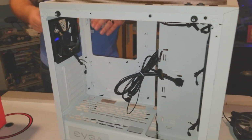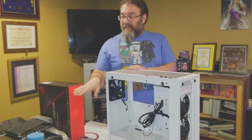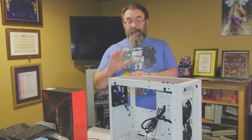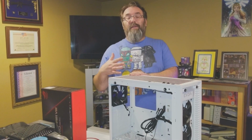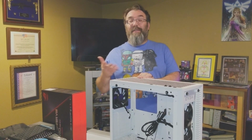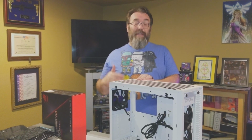That way, if you have a really nice graphics card, it's a nice way to be able to show it off. Performance-wise, I don't really think it affects performance very much. From what I've seen, the cable doesn't really affect the actual throughput of the graphics card itself or the slot, so I'm not worried about that. Cooling-wise, I think relocating it like that pulls it away from the main board, so it keeps the heat source away from the main board, so I think it'll help keep the main board a little cooler. I haven't seen any numbers that really suggest it does anything to help that, other than aesthetics. So I'm not worried too much about cooling or anything else, especially like I said, she doesn't run super high graphics, but I'm going to enable it to where she can in the future.